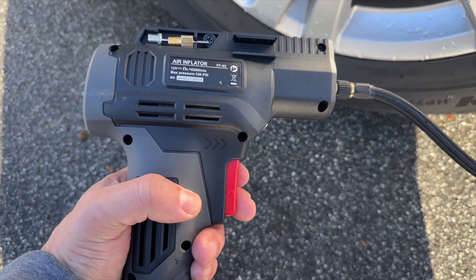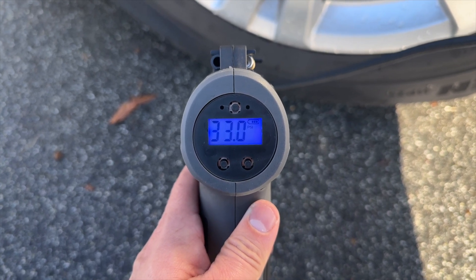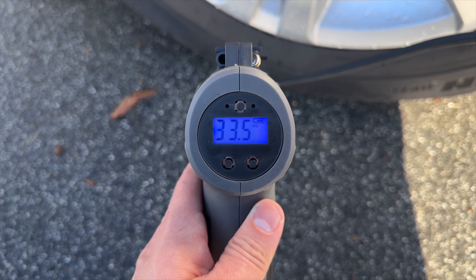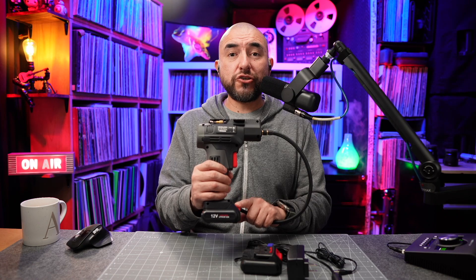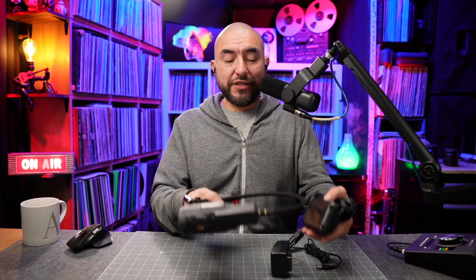This is a very cool unit — it works very well and inflates your tire fairly quickly. It's something I like having in the garage, and when traveling I make sure to fully charge the battery and take the cigarette lighter power adapter with me in the car, because you never know if you're going to get a flat. More often than not your emergency spare tire always needs to be inflated a bit since it loses tire pressure over time — the spare tire won't do you any good if it's almost flat too. It's always a good idea to have an air compressor in the car when traveling.